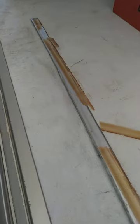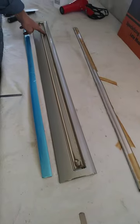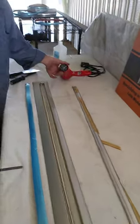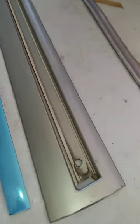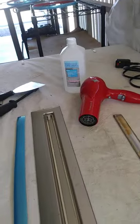There's the channel that we'll be replacing the molding in. Now what we want to do is get as much of this old adhesive out, which you can either scrape or use a hair dryer — anything that will soften it to help you get it out of there. Clean that out as best you can. Some rubbing alcohol to make sure it adheres well is always a good idea.